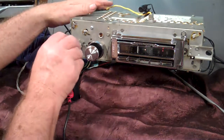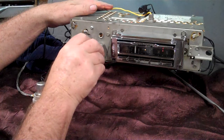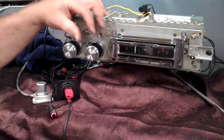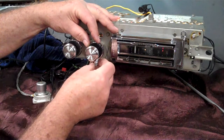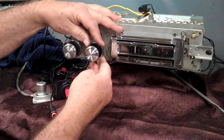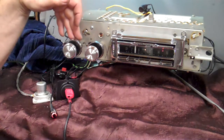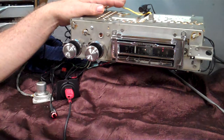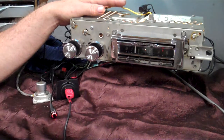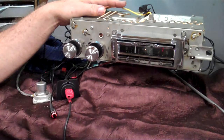Let me find a station with some music on it so we can demonstrate the balance. It has a built-in fader — there's your front speakers and your rears. It also has a balance built into the treble and bass control. You're going to go counterclockwise twice on it — one, two — it's going to beep, and after that when it quits beeping you're going to be in the balance mode. You can go from right to left until you find what you want as long as you're moving that pot. When you find what you want, just stop.